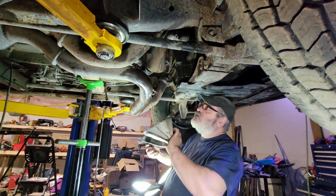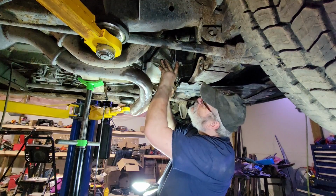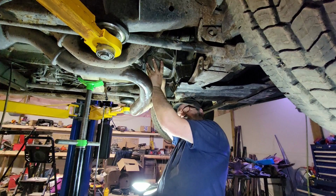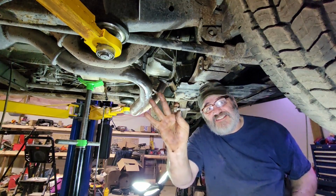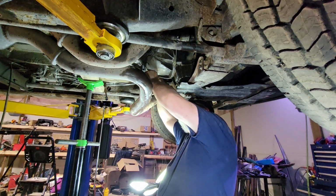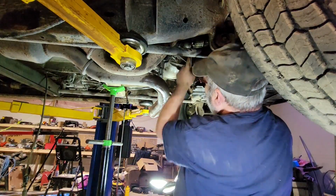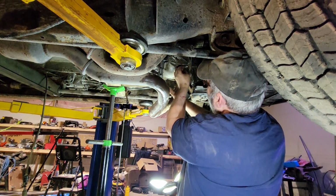All right, torque converter cover. Yeah, that way. Starter's already on, as the astute among you have noticed. Nothing to that. And it's held on with the biggest damn bolts you've ever seen. I don't know why you need six of these suckers to hold on an aluminum cover. It's not structural, it just keeps dirt out. Well, I guess it does add some structure, otherwise why would it be so beefy? I don't know, but okay. So you've got four there, and then two that go into the oil pan right here. A lot of bolts to hold on the dust cover.